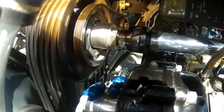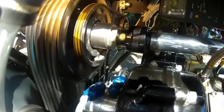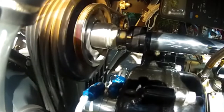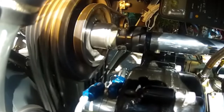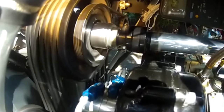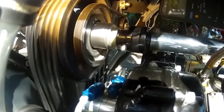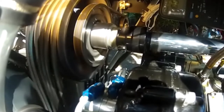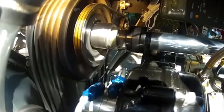Because of the way this clutch system works — tilting the front end of the engine down to increase tension — the two pulleys are going to be out of alignment. There's no way to get around that; it's just a question of how you set it up. The point of me showing you this is just to call your attention to how critical this all is. See the engine moving around? Remember, that's pretty well hard-mounted to the frame.